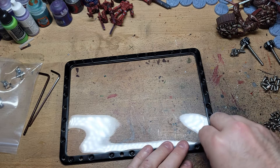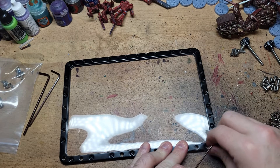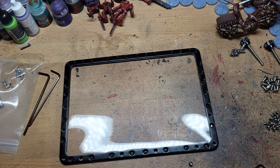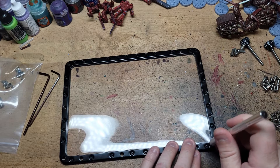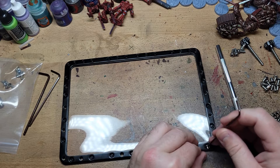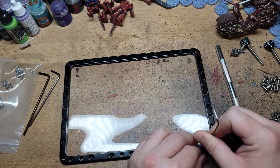When replacing the screws with the new FEP in there, I noticed I was concerned that pushing the screws through the plastic might stretch it. So I ended up grabbing an X-Acto knife and pre-poking a little hole for the screws so they wouldn't fight them too much. That way I wouldn't end up with a FEP that was stretched or got torn in some way.